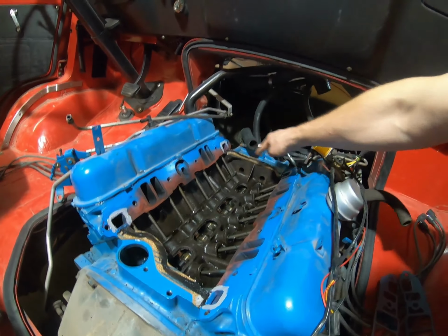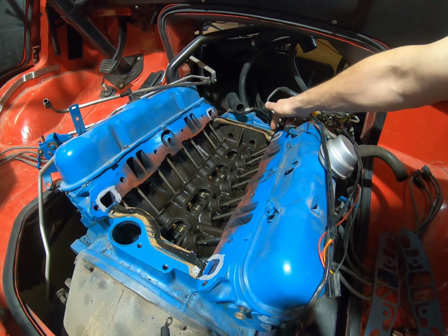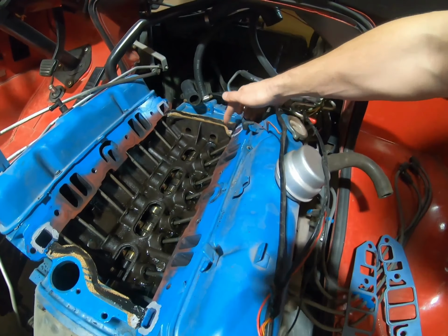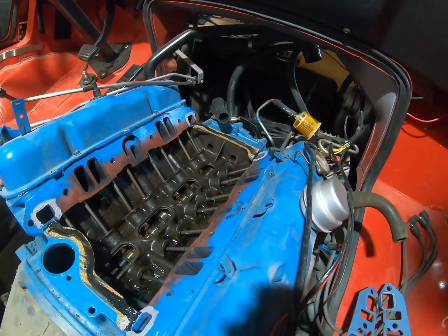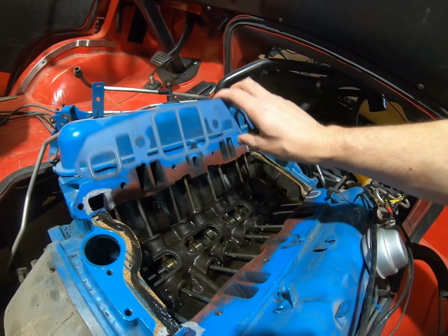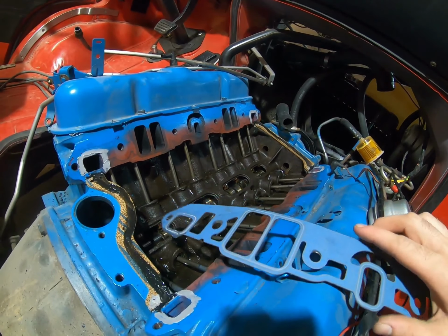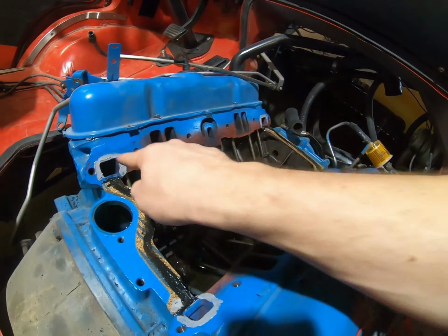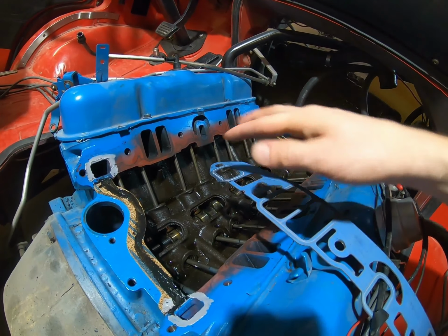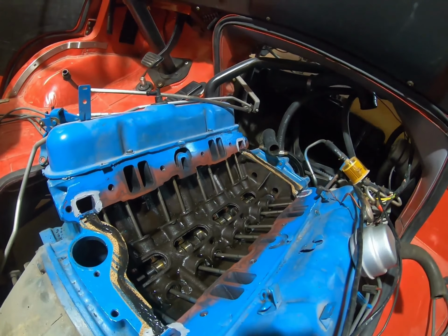Okay, did the same thing up there. Make sure you seal all the way down. See, this is a lot wider on this part of the cork gasket over here. So make sure you come back all the way to that corner. That's the sealing surface. Okay, now I'll go ahead and put the gaskets back in, and then when I do, I'm going to put another coat of the gray, just a smear all the way around here, okay, on all four, and then we'll replace the manifold.